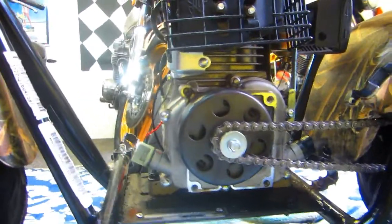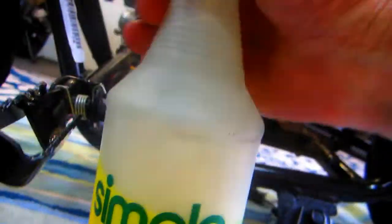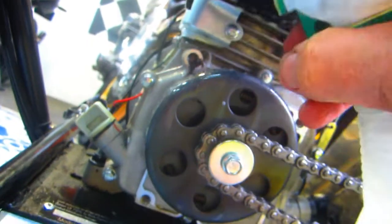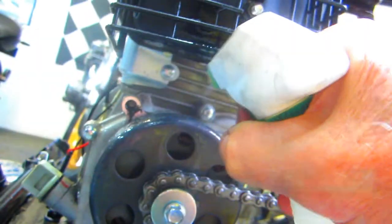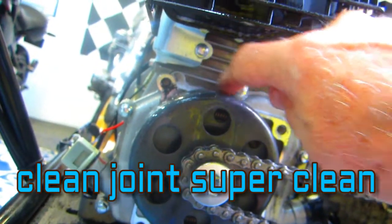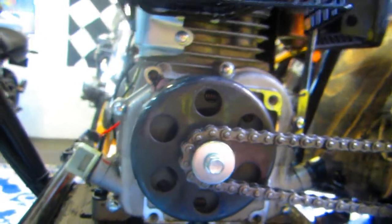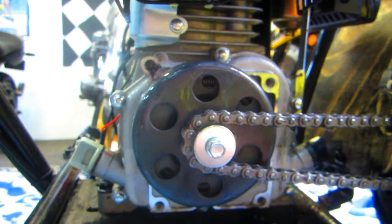The first thing I'm going to do is check if we torque down the bolts - maybe some of the bolts are loose. But I think if we have to make a gasket we can pull this side off the engine and make one. It's only leaking in one spot, so I'm going to try to use gasket sealer on the outside to seal it. All the bolts are tight and we have nothing to lose - if this doesn't seal it, I'll have to pull the side of the engine off and put in a new gasket or make one.